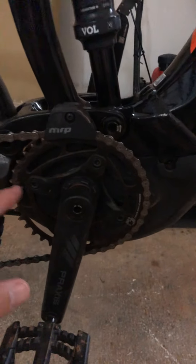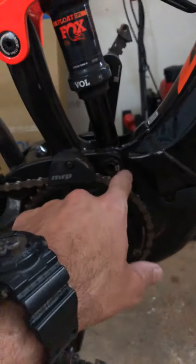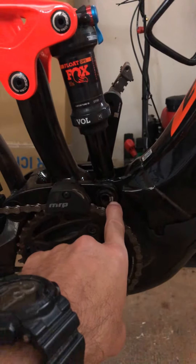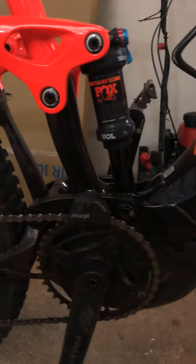And they don't go in there really deep. This one was loose and this one was loose. I've since Loctited them and haven't had any issues — this is where I was getting the most creaking on this one. That's where I learned it. So mark these bolts. Stop the creaking.